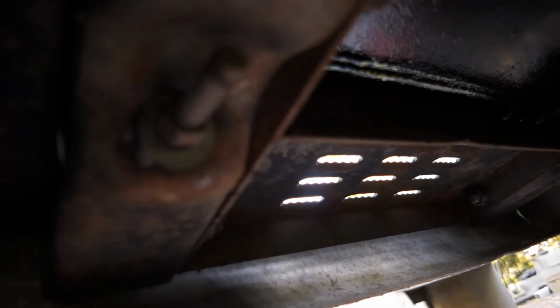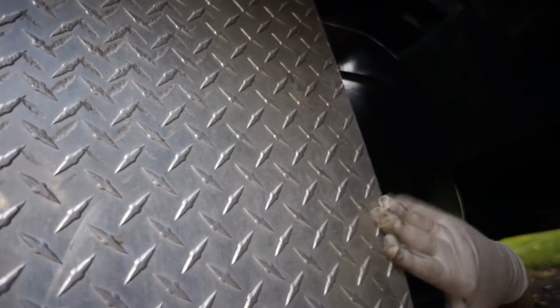All right, guys, so I'm up underneath the truck right now, and you can see that belt bracket I was talking about. This is the bolt right here. Hopefully it's zooming in on it and not getting my finger. Just loosen these. We've got some anti-seize grease on these, so they're very easy. There's one there, and there's one right there. I also forgot to say, after you undo the two bolts underneath for the belt straps, this is the side of the gas tank behind the driver's seat. You've got these pins right here. They push through, and there's a cotter pin on the other side. Take that off with the washer and pull these out with some needle nose, and then the belt straps, you can see them right there, will pop up out of it.